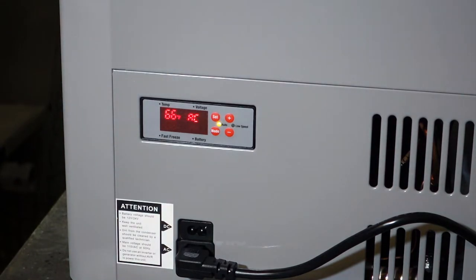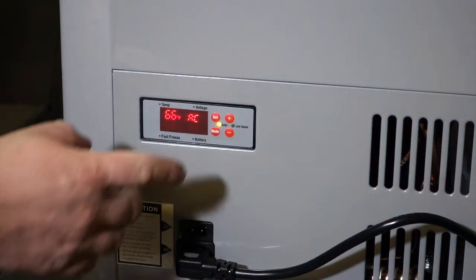And the reason you might want to do that is because if it's run to the fuse panel, one, it's protected externally. Two, I'm able to turn off power to the fridge entirely if I want. Again, this plug is right here. It's easy to reach. So I may just run it directly to the battery. So if I don't need the fridge and I don't want to have a parasitic drain, I can just turn it off.